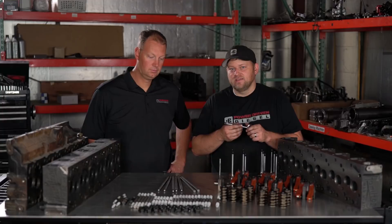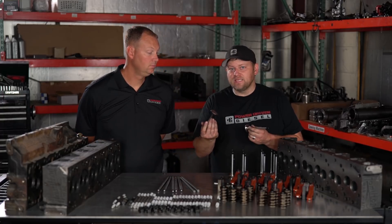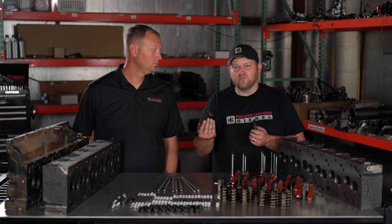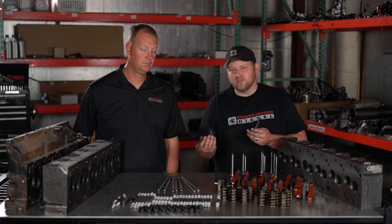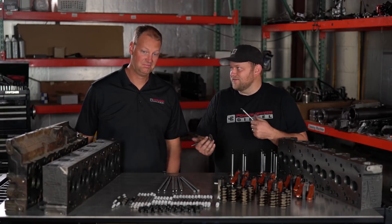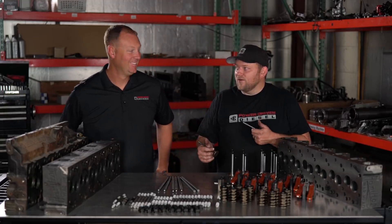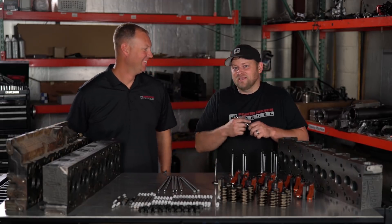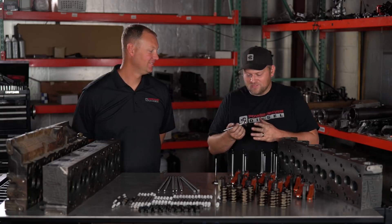Since we're on the topic of valves — we decided if we're going to get custom valves made to fit the Warhead, we want something that will hold up to the heat and extreme abuse a performance engine gets. A factory 12-valve Cummins has an Inconel exhaust valve and a stainless intake valve, because they need the Inconel for reliability for a 300,000-mile engine at factory power — about 1,200°F EGTs. On a race engine, EGTs get quite a bit higher. My truck almost hits 2,000 degrees.